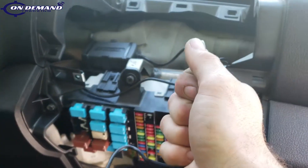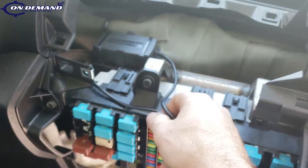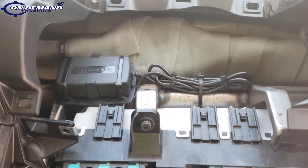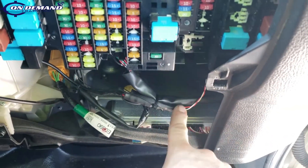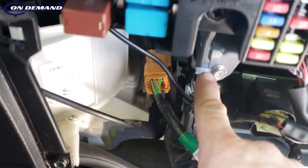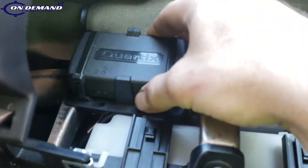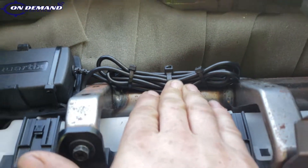The final step is taking care of our excess cabling — I'm just going to bundle this up with some cable ties and we'll put our dashboard back together and begin testing. So now our installation is completed. To recap: we have our wiring done at this plug for 12-volt constant and ignition, our ground on this ring terminal, our unit mounted on this metal support bar nice and secure, and our excess slack tied off.